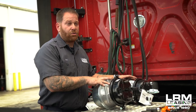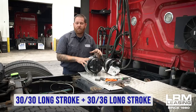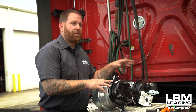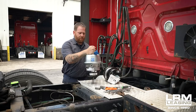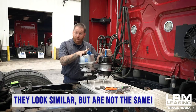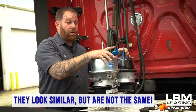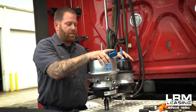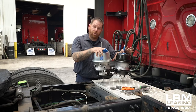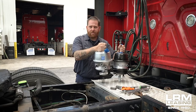I also want to show you how to install them. First, I'm going to show you guys the difference. We have a 30-30 long stroke here and we actually have a 30-36 long stroke brake chambers. I have seen cases where they put the 30-30 with the 36. By looking at it, you can see that from a distance it's almost about the same, especially when it's dirty — from an optics view it may look almost the same. But if you actually pay attention towards the top, the one in my right hand — you'll see it's silver, and the top is a lot bigger compared to the one on my left. So the one on my right is a 30-36 brake chamber and the one to my left is a 30-30 brake chamber. The one all in black: 30-30. The one right here is a 30-36.